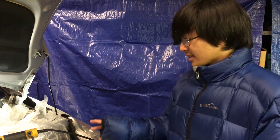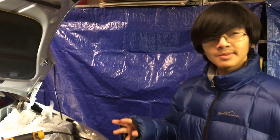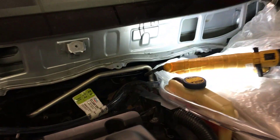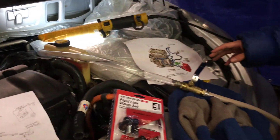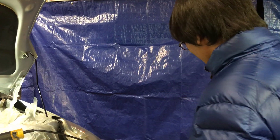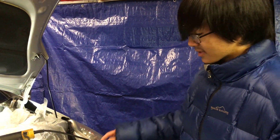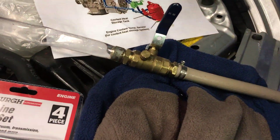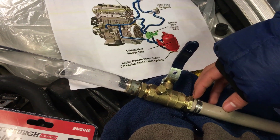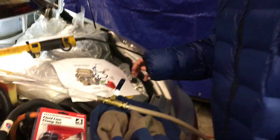It's very important that we open the valve very, very slowly because tap water normally comes out around 30 to 60 PSI, and the system can only handle about 10 to 15 PSI. That's why we want to open it slowly. The pipe is around 75 feet away and hooked all the way around the garage in order to get it here, so we can't control it from the main valve — that's why we have a second valve right here. If we let too much through, the heater core will not be able to handle it and it will break. If the heater core breaks, you're going to have to open your dashboard and everything — it's just too much of a hassle.